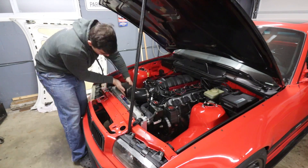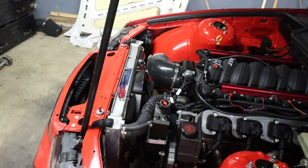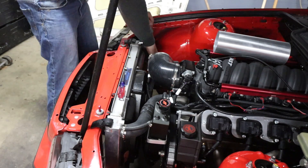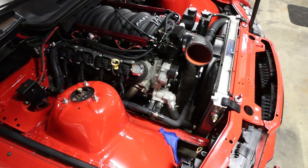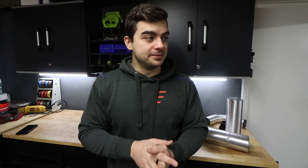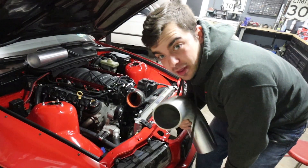The plan for the intake is to route it over just kind of how it was, but then take a 90-degree turn down and head down into the fog light slash bumper area. I'll figure out exactly where the filter is going to end up once I get the rest of the parts. There's going to be a silicone coupler on the throttle body, and then one more coupler where it snakes down through that tight hole, because I can't make the intake out of one piece and fish it all the way through — it needs to be in two pieces. The silicone also won't damage the paint or vibrate on metal since it's pretty tight, and it'll be able to squish to fit that hole, which is more oval than circular. Surprisingly, I can actually fit a four-inch pipe down there behind the headlight, which changes things a bit.